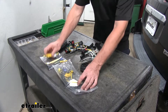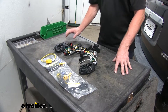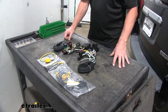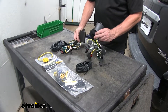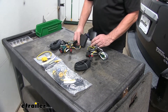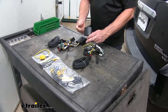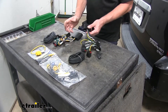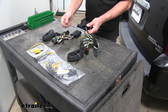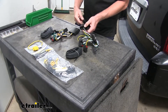Also a similarity: they both have a very high-quality fuse holder from the manufacturer, so you can't go wrong on either side there. And both of these wire harnesses are designed to work with your car and your trailer by using the battery power that sends power to the unit, and then it copies the signal from your vehicle out to your trailer. So if your trailer has any problems — like a short — the box will turn off the circuit, protecting your vehicle so you don't blow a fuse.